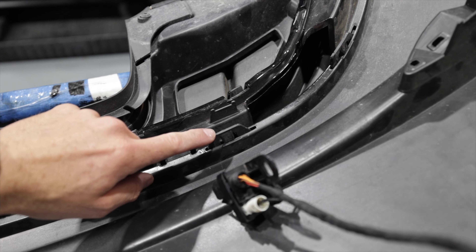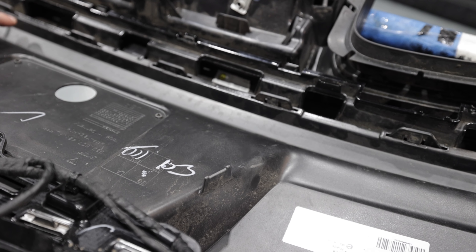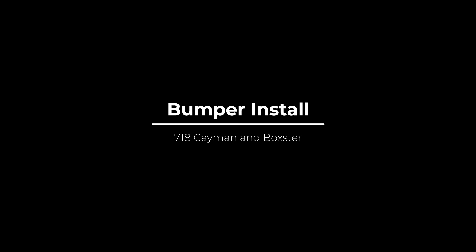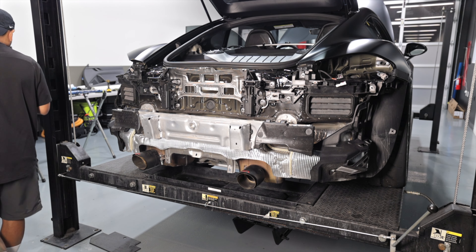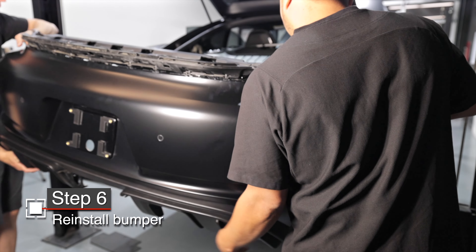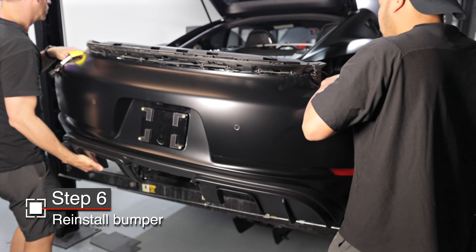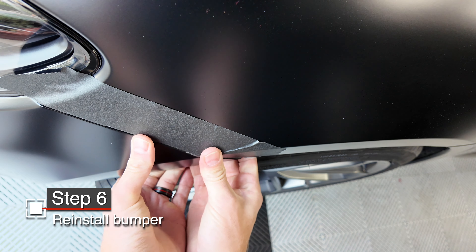Those stiff plastic clips don't make it any easier to install the diffuser either. Once you put it back in, you may want to lube the clips up. It just took a little hitting with the palm of my hand to get them all to fully seat. Take a close look underneath and make sure they're fully seated — when you're ready to put the bumper back on, carefully bring it back to its position. Be careful with those bumper wings as they tend to scratch your quarter panels, so protect them.